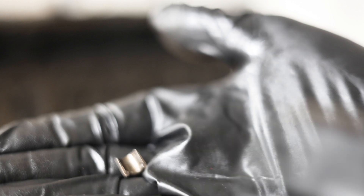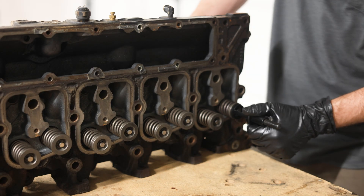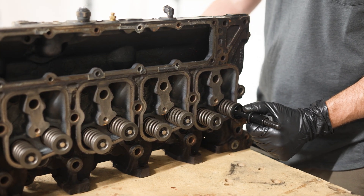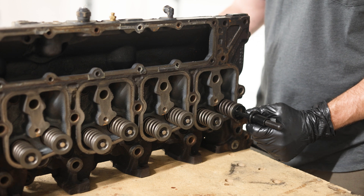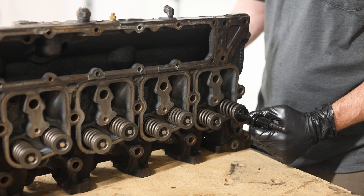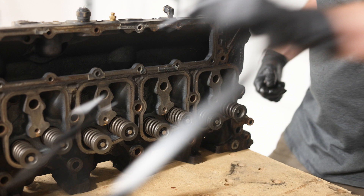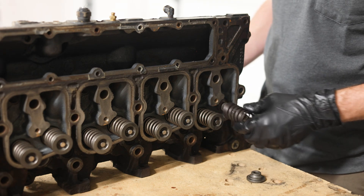Here's the keeper — here's the other one. I found it, luckily. So we'll take a little more precaution with the next one, but we can go ahead and start loosening the valve spring compressor gently, and that'll give us our retainer and our valve spring. Good opportunity to utilize your protective eyewear whenever you're compressing springs — it can always be a somewhat risky endeavor. Eventually this will just loosen up enough to where our retainer is going to fall out and give us access to our valve. That'll be loose enough — take our spring compressor out, take our retainer and our valve spring out.